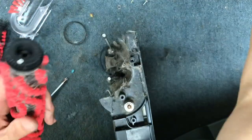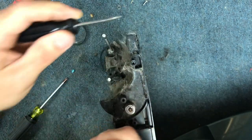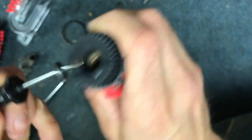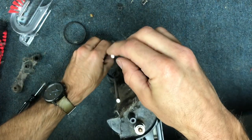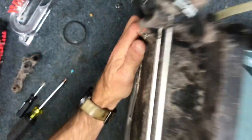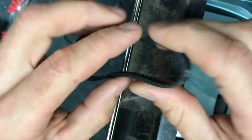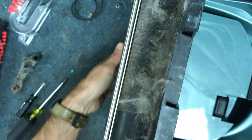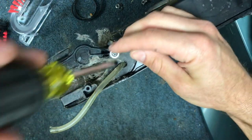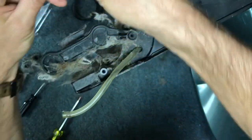This one's kind of stuck in there, so I'm going to grab it like that to pull that out and set that aside. The stainless steel washer is still right down here on the first one, so I'm going to take that off. Now I can flip it over and pull this belt off — this is the large belt. You have two belts, and the part numbers I will put in the description so if you're curious about what part numbers to order, I will put that in the description for you. For this assembly, this is your holder, and the only reason I'm going to take this out is because I'm going to clean it. So take this other screw out and this just lifts out of place. I will go ahead and wash all this down — usually this stuff cleans pretty easily. You just want to be careful not to get any water intrusion around where this motor is. I'm going to rinse this area, take a toothbrush and wash it clean, and dry it off.